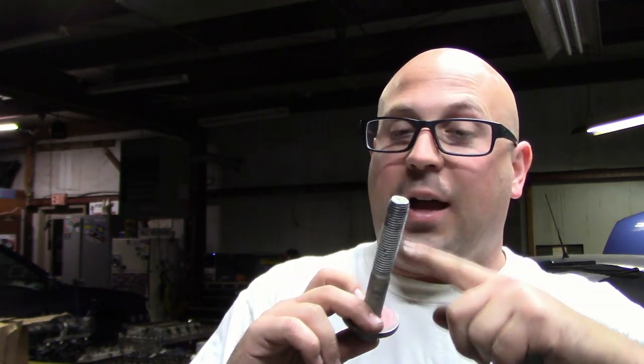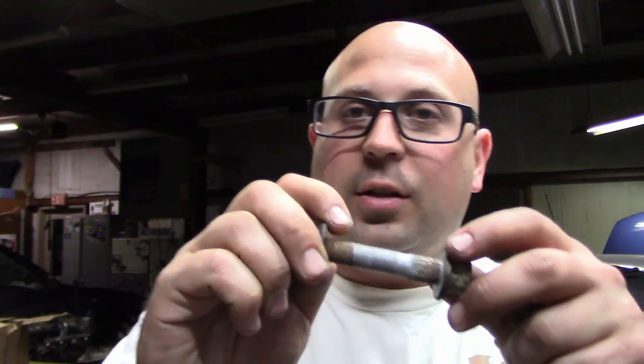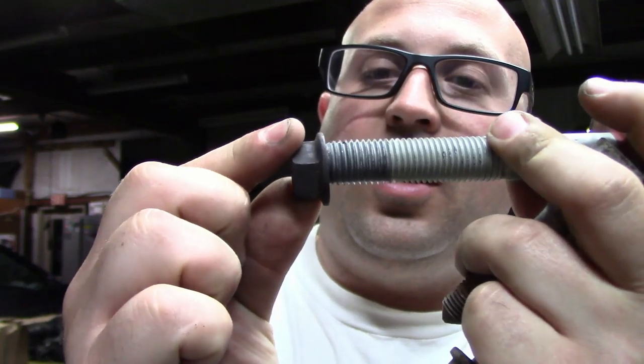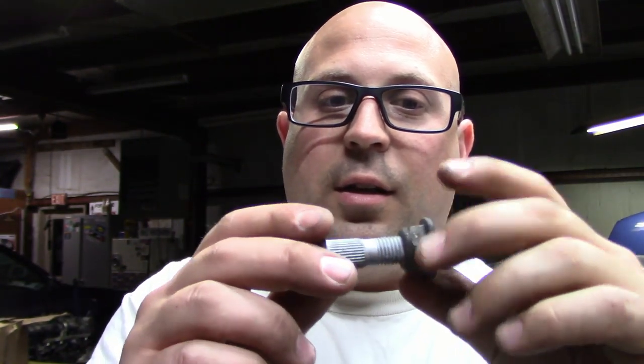So, backing the crank bolt out most of the way didn't work, because the problem was I ran into the fact that this is not long enough. What I did was I looked for a screw and a nut where I had a squarish head that it would fit over, and a nut that was bigger than the threads on the crank bolt. I set it up like this, so that way I'd be able to push on it. It would still have a centering bit. I'd be able to push on this edge, which you can see where it pushed,